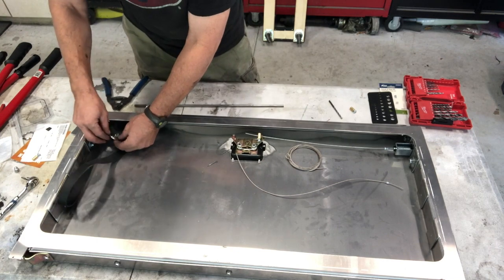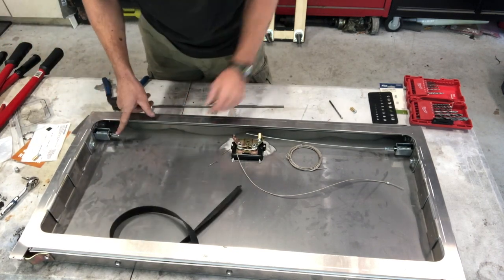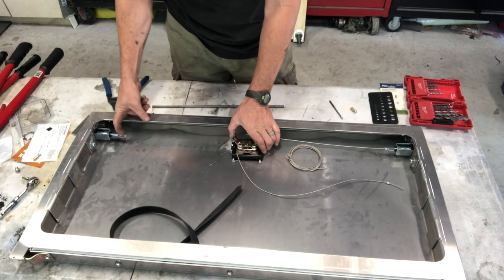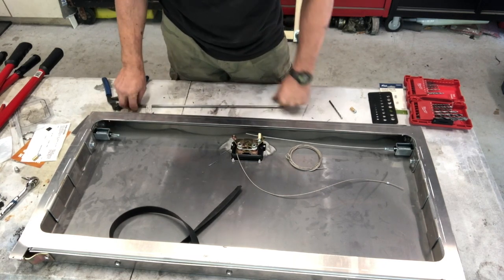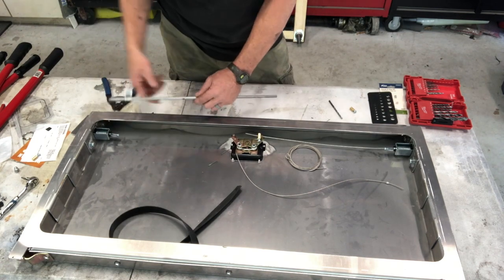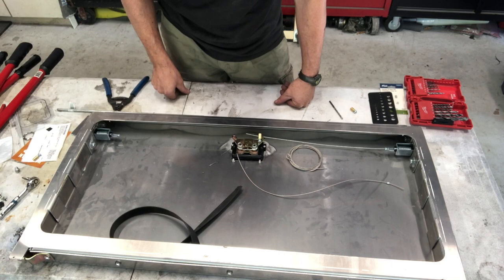well, let's get this out of the way so we can see here. Put a bend through the end of the side latches, and then as that rod pulls in, that's the way most tailgates work. You could put a little plastic snap keeper on so that it doesn't jiggle back out. So that's another technique, with a rod.